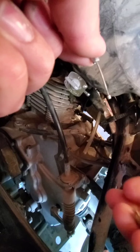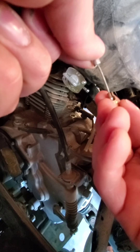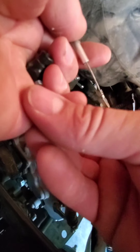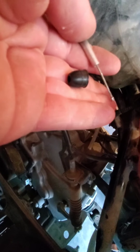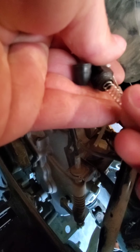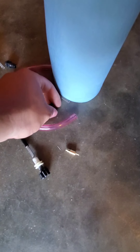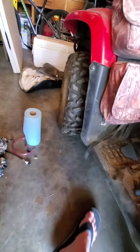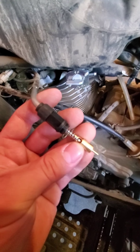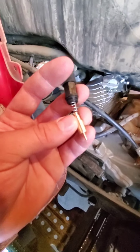Now it's time to put her in. This is the wire that goes to the choke on the left side of the handlebar. There's going to be a grommet up on top, then this piece slides up on top of that, and the spring will be inside behind the needle piece. You'll have to pull the needle piece out and shimmy it off so you can put the new assembly on. If yours doesn't come with one, reuse the old one. The finished product will look something like this — don't worry if the hole looks too big; it's the same diameter as the old one.